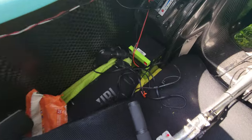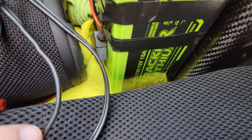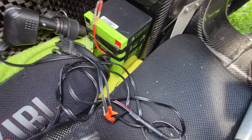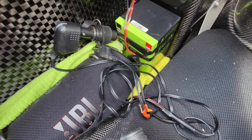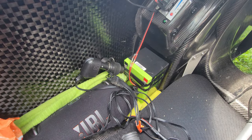The battery I chose was a Tracker Lithium Iron Phosphate — a LiFePO4 battery, not a LiPo. You don't want to run a LiPo battery in these because it gets warm in here, and LiPo batteries are very sensitive and damaged very easily. This LiFePO4 battery will run probably about 48 to 50 hours before I need to charge it, and that's running all my lights all the time. The only problem is on low beam — sometimes it doesn't work for some reason; it just flickers.